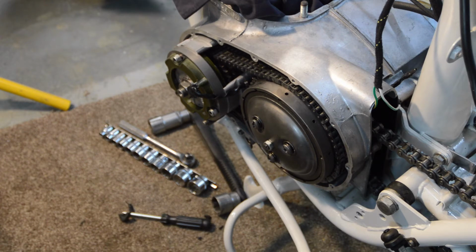First up, the main black sleeved stator wire wouldn't pass through the eyelet cleanly. So I then taped the ends down, made a nice little cone shape, Vaselined it, then it would pass through, but would only go in a short distance or it jammed. So I then tried using a draw wire by passing electrical wire through first and taping the stator wire to the electrical wire to try and draw it through. It kept coming apart because it was too tight.